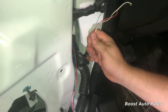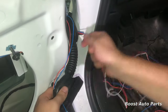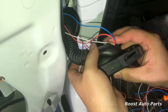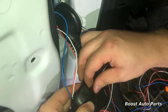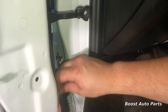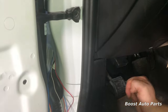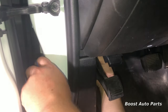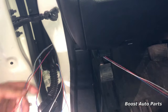Pull all the wire through, being careful not to chafe anything. Get your rubber boot back around — just do this by hand. Now run the wires in through the little hole. It's easiest to put a little extra slack in there, as it'll make finding it on the other side easier. Run a little bit in and go to the other side to grab it. Once you have it in, carefully take all the slack inside, being careful not to chafe any wires on the metal.